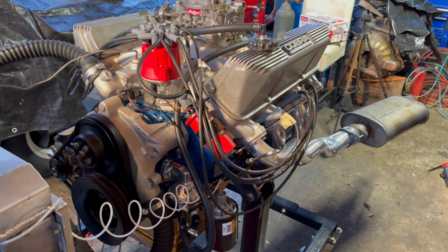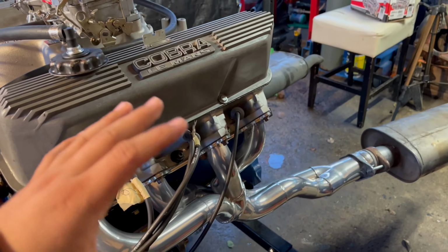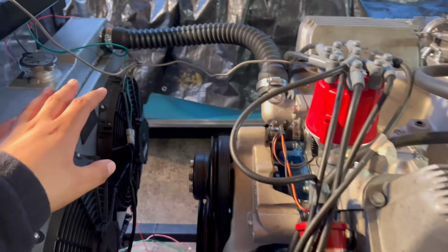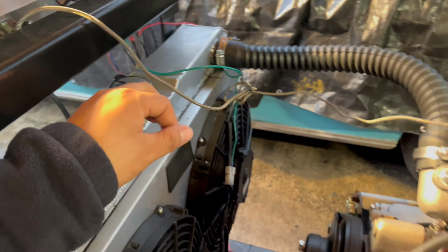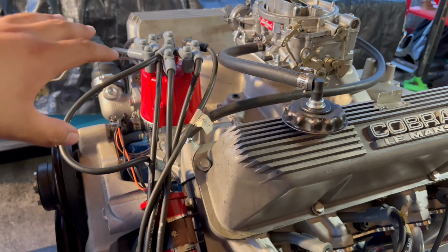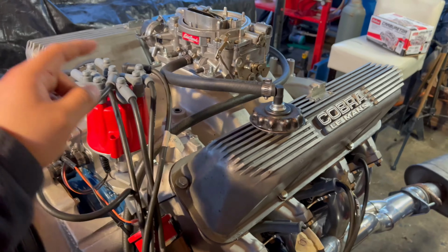But I started to think, what could it be? Why is this happening? I knew it wasn't the cylinder head gasket, because there was no smoke blowing out the tailpipe. And I looked at the inside of the radiator, and there was no oil floating on top. So I thought, this has to be something that is mixing, maybe one of the ports. And I remember reading that it's very common for the intake gasket to leak coolant from these two ports right here.